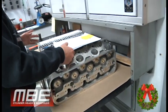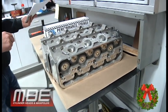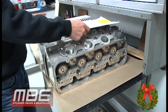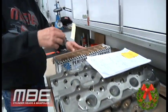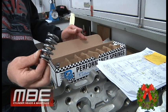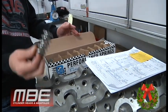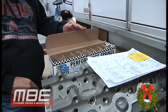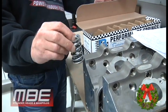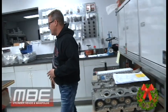This is a cool one — it's a set for trophy truck. There aren't a lot of engine rules in trophy truck, so I think this one's going to be insane. It's twin-turbocharged with the Dart MBE LS head and I think it'll be awesome. Because it's an endurance application, we're using the small spring. Joe Hornick designs these springs — a lot of higher-end racing uses his spring technology. PSI makes the spring but he designs it and we have access to it. That little spring is going on a twin-turbo engine that will probably make around 2,500 horsepower — and it will work better than a larger spring.